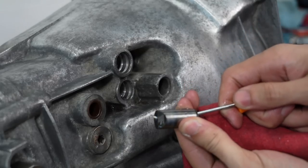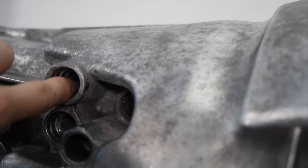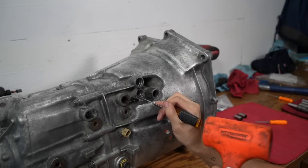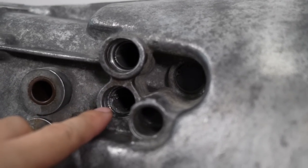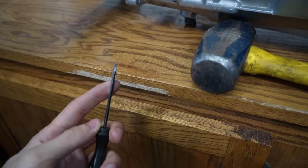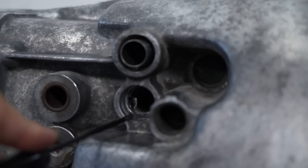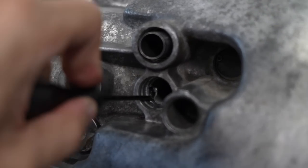These came out like butter — this crazy Harbor Freight pick actually grabs it perfectly, goes right on there and just pulls it right out. Now the part I struggled the most with on the E46 was getting that little inside sleeve out. You got to get a screwdriver behind it and bang it out and pull it out. This part is still just as bad as I remember. I can't get under the sleeve to curl it back — I think my tool is too blunt. I need to make it sharper, so I sacrificed a little thing in my toolbox and ground the face down so that I could have a pointy screwdriver.